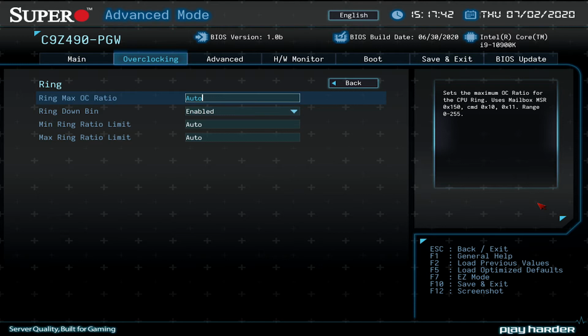Now, one thing to note is that when we perform an all-core overclock, you can lose single-core speed, because this chip, the 10900K, is designed to use TVB and boost up to 5.3 gigahertz by default. Now, if your chip can't do all-core 5.3, which ours is right on the edge of, so we're going to be pushing more for a 5.2 clock, you will lose a little bit. You'll lose a few percent of performance on your single-core because you're losing technically 100 megahertz when it does boost up to that.